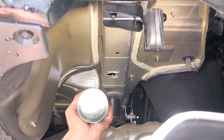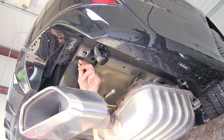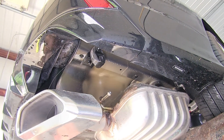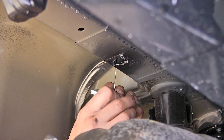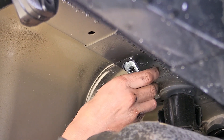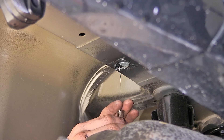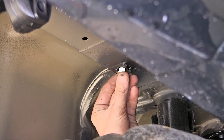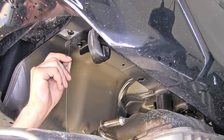Now we'll use some paint to spray around the hole so we don't have any bare metal — this will help prevent rust. Now we'll take one of our pull wires, go through our rear hole here, and come out the access hole that we enlarged. We'll take one of our blocks, place it on the wire, and stick that inside the frame. Thread on one of our carriage bolts to the wire and place that inside the frame as well, then pull the bolt down through our hole.